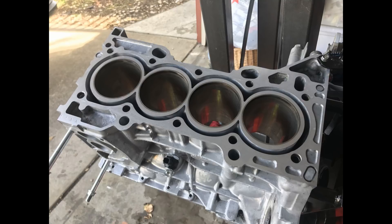I ended up taking my block to the machine shop and it seems like the sleeves had lifted up a tiny bit, so the sleeves were slightly higher than the block itself by just 1 or 2 thousandths of an inch. According to the mechanic, they took off around 3 thousandths of an inch off my block. My head was untouched because it was completely flat. Just to give you a reference, a sheet of printer paper is around 4 thousandths of an inch, so they took off just a little bit under the thickness of a printer paper.